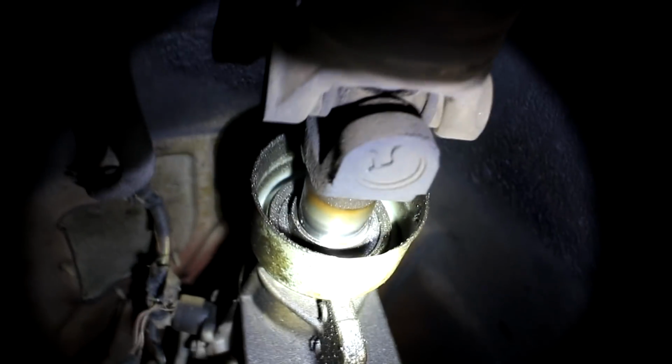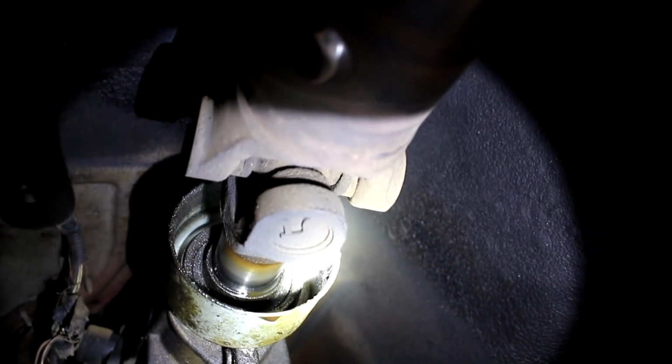And then back to the back of the transmission, you see that exhaust mount, and then this transmission mount here is all wet, and that's all coming from up here. This output shaft seal on the back of the transmission is also leaking, so that needs to be addressed. And the drive shaft actually seems to be okay. You can check it by shaking it up and down and seeing for play in the U-joints.